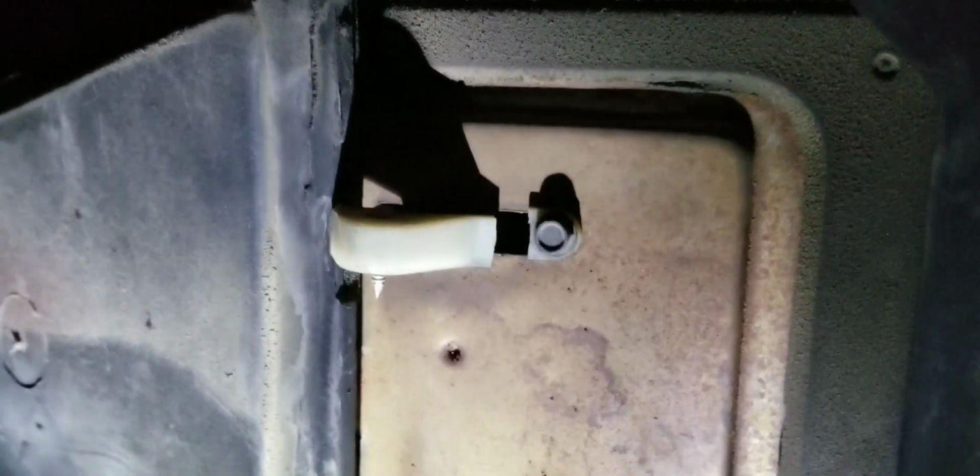The other thing is this is a common Chevy problem with this breaking here. And then your door here does not work. And so that's that actuator that pulls, you know, all this is all vacuum ran. There's the vacuum back in there. And there's another one in here somewhere. But anyhow, this always breaks.